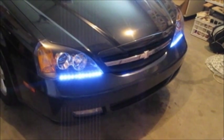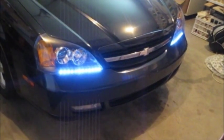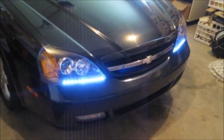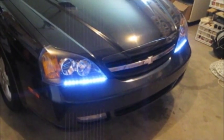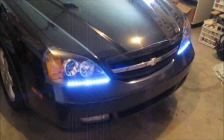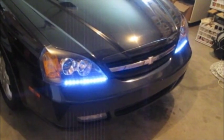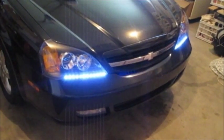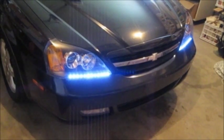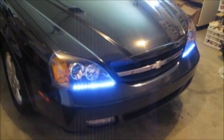Just a little bit of history with this car. This is my 2004 Chevy Epica. It has running lights that come standard on it but these have been disabled — all I did was go into my fuse box and pull my running light fuse out. That triggered a dash warning light, so I took apart the dash and pulled out the little bulb. The reason was problems with the computer — when I got the car they never worked, and after a few years they'd randomly come on for about 5 minutes then shut off, which got really annoying.